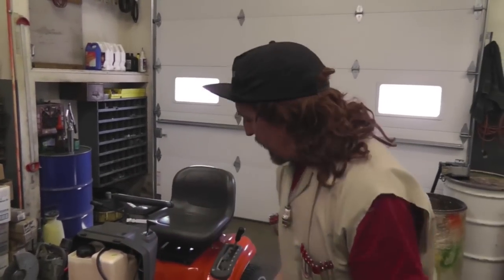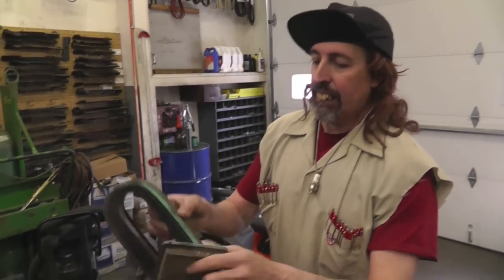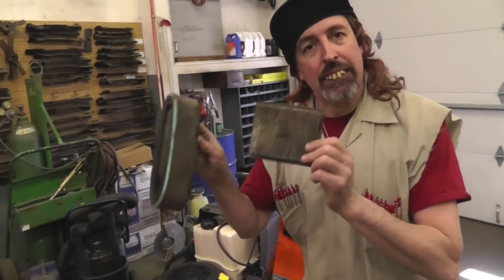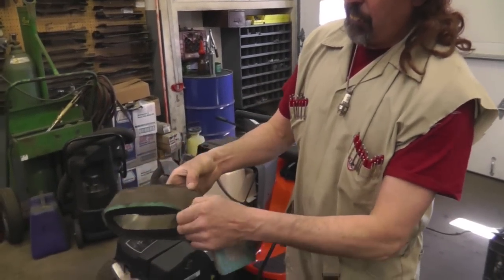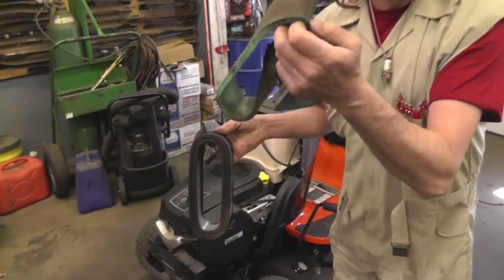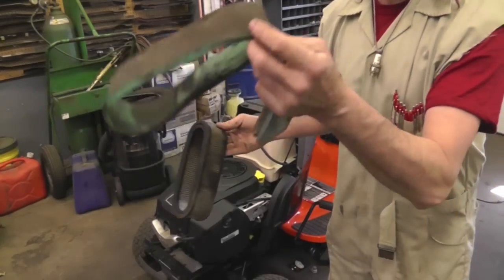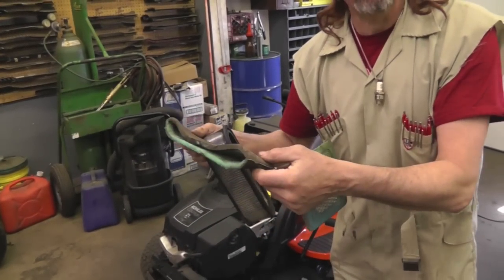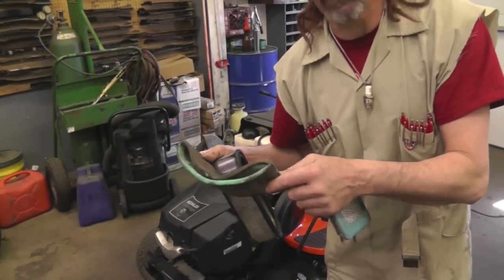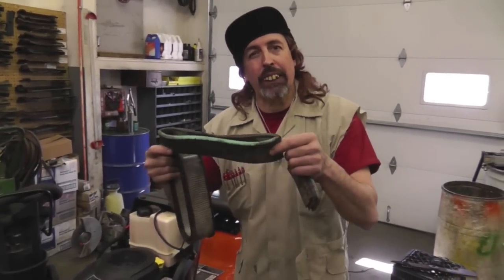The engine is like a vacuum cleaner, sucking in big amounts of air, and you've got those blades — big old fan blades — kicking up dirt and dust. Where do you think all that dirt and dust is going? Right into this air filter. New air filter every year is most important. And if your mower has a two-stage filter, buy a couple of extra outer foam filters — if you change those more often, the inner filter will stay cleaner longer. You can also clean the foam filter in soapy dish water — not gasoline, not carb spray — just soap and water and let it dry.